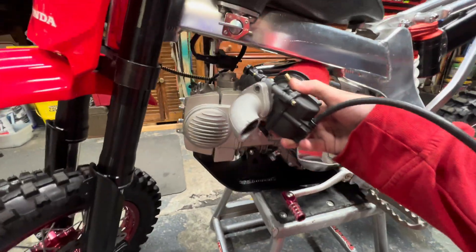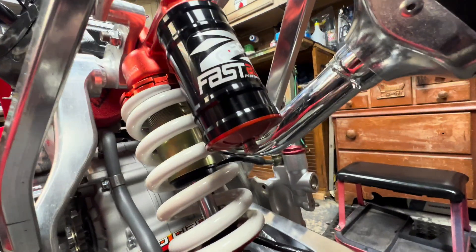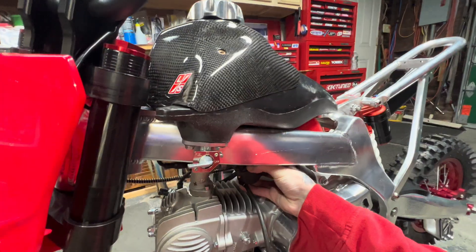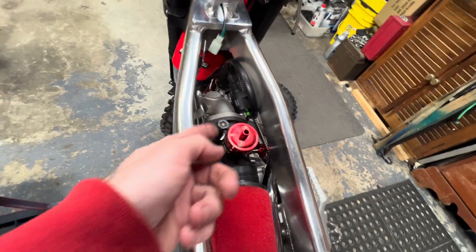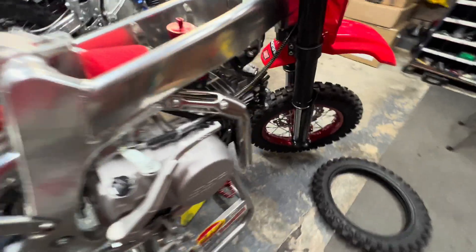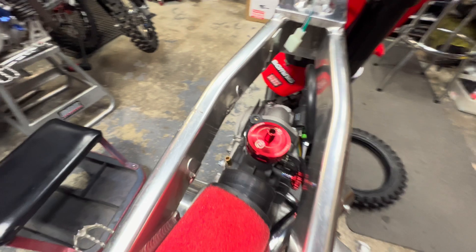It's still going to be really tight. Basically the carb wants to sit right there — super close to the exhaust, but there's a little bit of space. I pulled off the gas tank so you can see in there better. With the Nibby I'm able to reach under and hit the plunger, the gas line will work out on that side, and I can get to the air screw right in there and the idle screw too. That's ultimately why I chose the Nibby instead of the Mikuni.